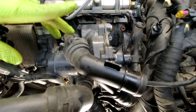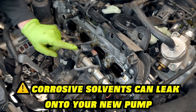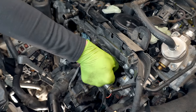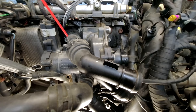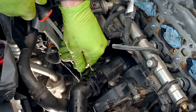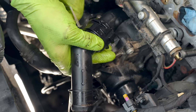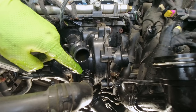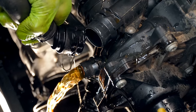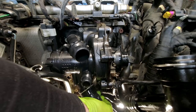Now it's time to remove the water pump. Before you take out the old pump, do any cleaning you're going to do up here first, then take the pump out. Try hard not to get anything into the cylinders. You can take the little plates out, stuff a rag in there while you clean. Now we're going to start removing the coolant hoses still attached to the pump. Do the top one first. We got one right below that with our pick. There's one more all the way at the bottom. It's not a big deal if the clips come off — I just worry they'll get lost.